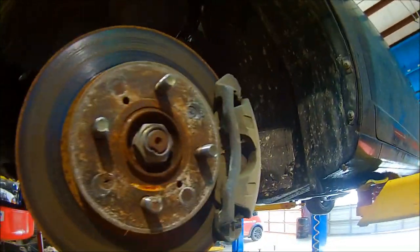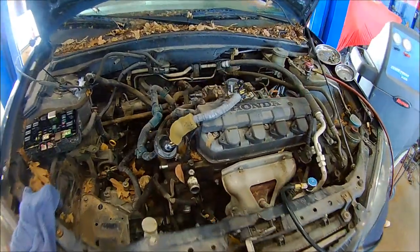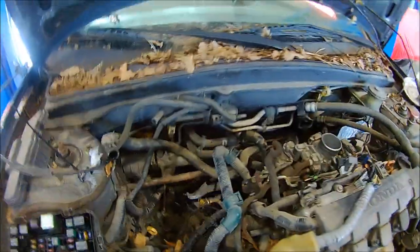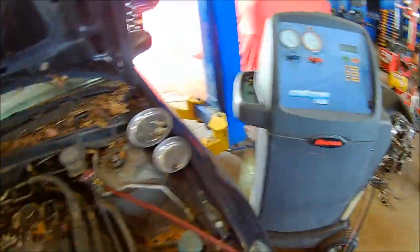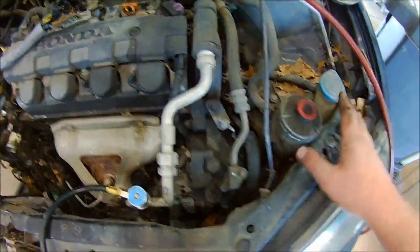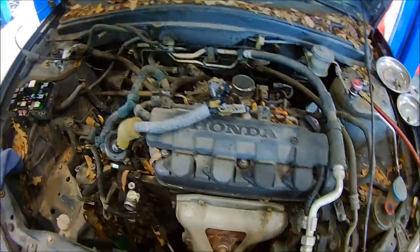Got to remove the exhaust first. To get the wheels off I'm going to take the brake calipers off and hang them up. I'm going to drop the cradle with the engine and transmission together — seems like the easiest way to do this. Getting close to the engine removal. I think I've got every hose and wire unhooked. I'm going to have to swap out the engine harness because when they removed it before they chopped it all up. Discharging the AC right now, taking the power steering pump off, unhooking the AC compressor lines, and unbolting the transmission mount, motor mount, and cradle — then it should be ready to drop out.